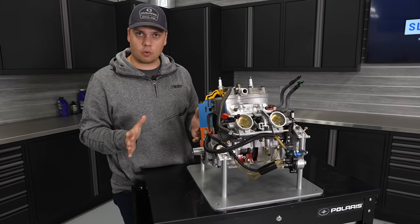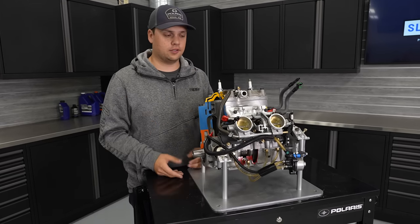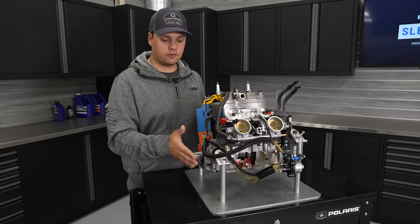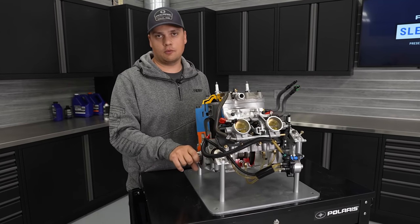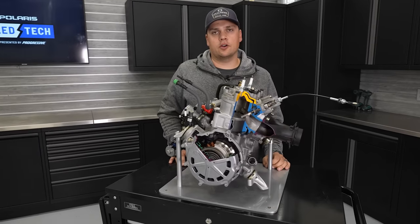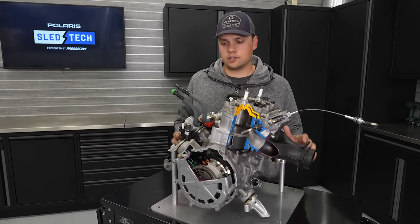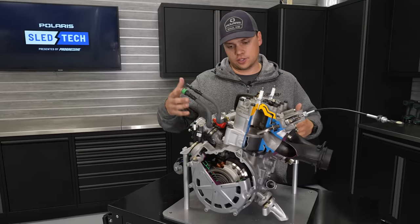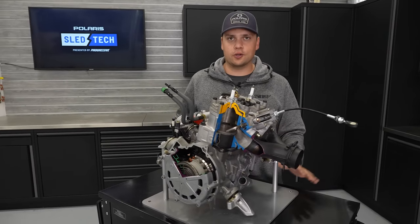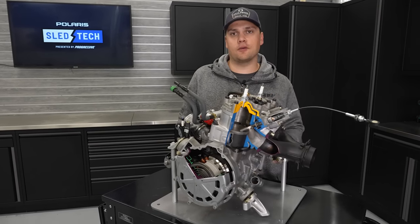Even though the crank got a little bit wider, which is typically a challenge for inertia — since low inertia wants mass close to the center — we were able to take weight out of the crank, put it in strategic places, and deliver a lower inertia engine that makes 10% more power than the 800 clean fire did. When we were developing the 850, we had a lot of things with the 800 HO that we really liked — it was a great engine with a great low inertia crank train. But we wanted to make big improvements on performance, and we had the chance to do an entirely new engine top to bottom, making sure we turned over every stone for its 850 form and mod versions down the road.